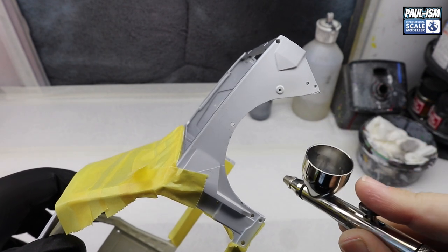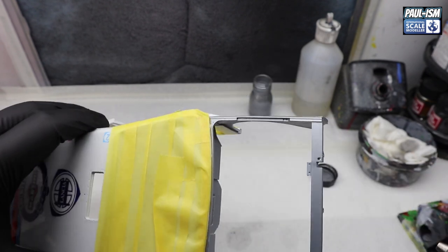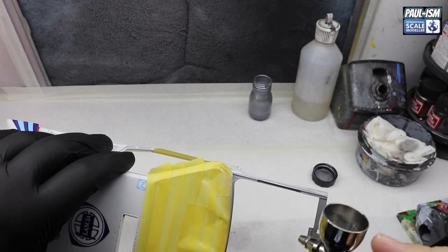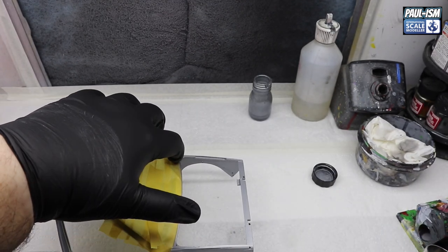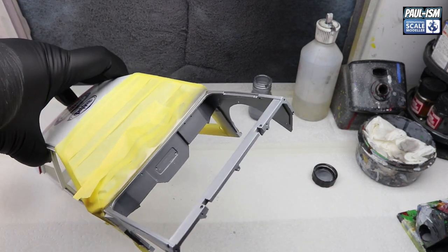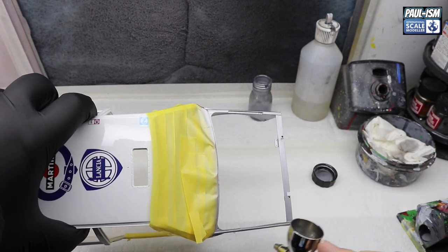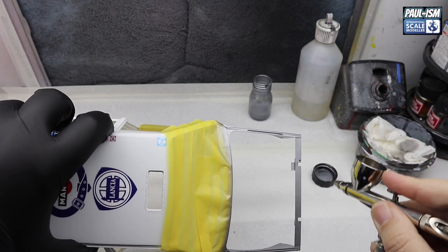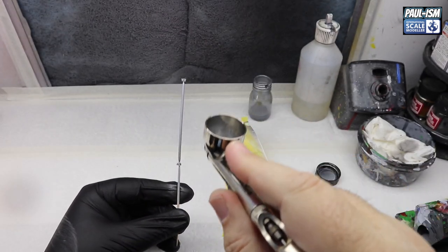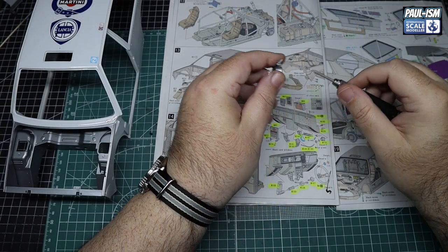The body has been masked up — we're going to touch in and re-spray all the TS17100 mix. Through various stages of painting we've got a bit of white paint on it and pulled some paint off with masking tape, so we've carefully masked it where we needed to. We're just going to touch it up on the outside and inside to make sure we get a clean demarcation of the silver paint. Using the 2mm Apex and the TS sprays — it looks much better touched up. Then we use the same paint on the seatbelt brace bar, and it's done.